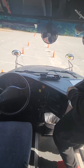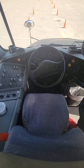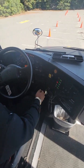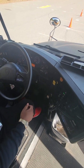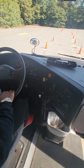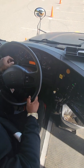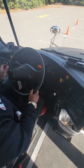Now we're going to start with our indicator lights, making sure all the lights on the dash turn on. We're making sure that our DEF light, our ABS light, and our check engine light all go off — those are the main ones we're looking for. All lights went off, so all my indicator lights illuminated and work properly. Now we're going to manually check our four-way flashes — they're working properly. I have my left turn signal, right turn signal, and high beams. Those are all working properly, with indicators on the dash.